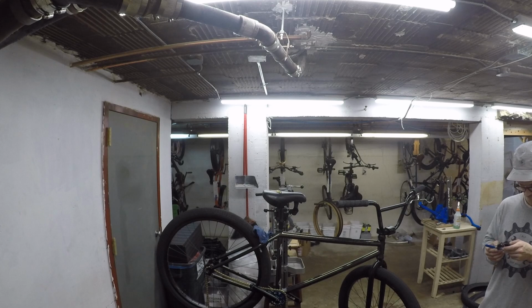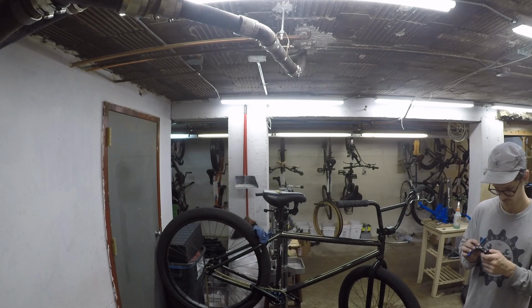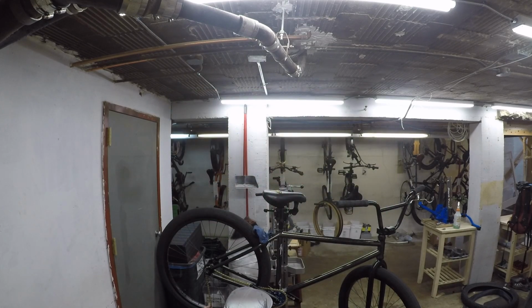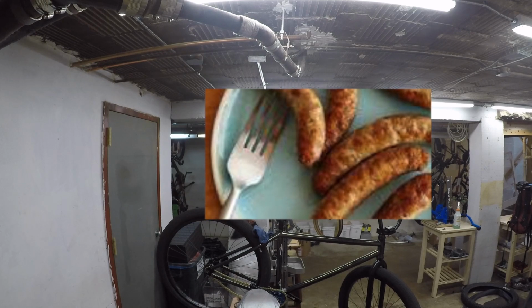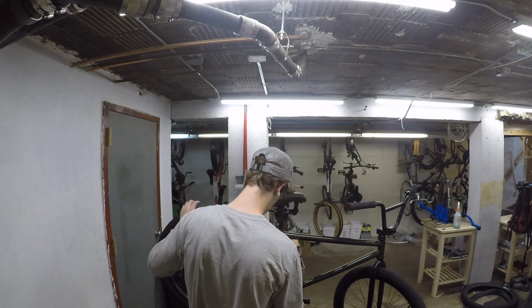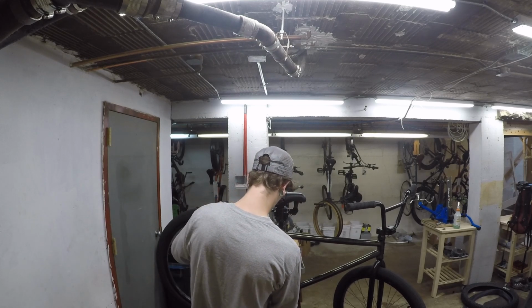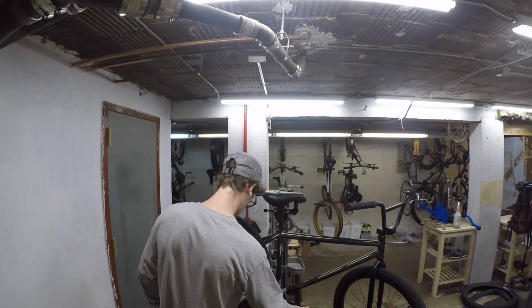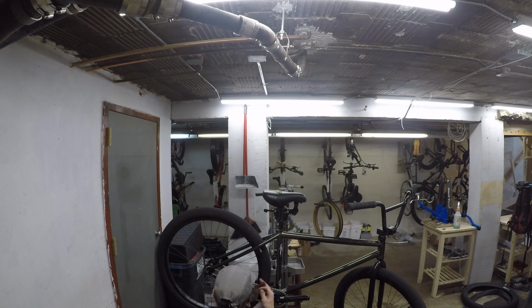And then I broke one of the chain tools, so here I am coming back. I press it on, and then I mushroom the tip because they're hollow links inside, and it got bound up. And so then you're gonna see me fooling around with the needle nose pliers, and I basically just got leverage on the link and the plates, and I just kind of got it loose so that it wasn't so bound up anymore. So that's what I'm doing right there, and that I would imagine will conclude this voiceover time for the moment.